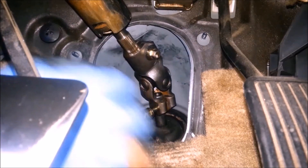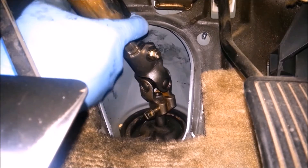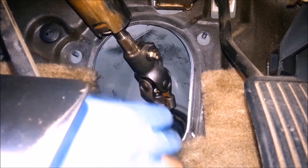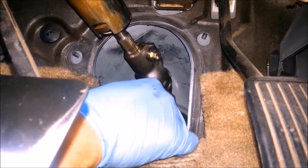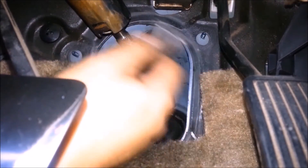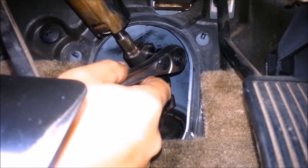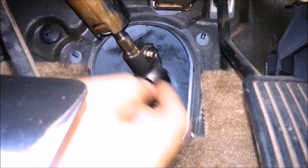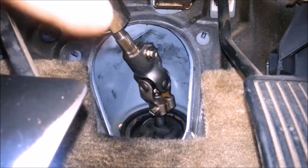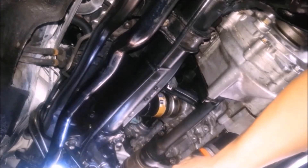You can see how it's holding itself in place now — tighten it up. I'm not going to completely tighten it yet because I still have to tighten up the steering rack onto the frame on the bottom. Then it's time to put everything on.